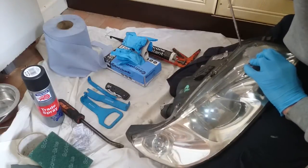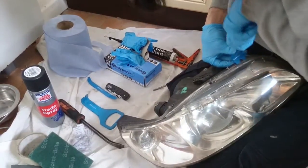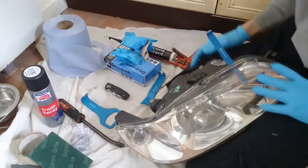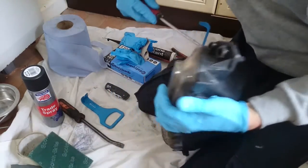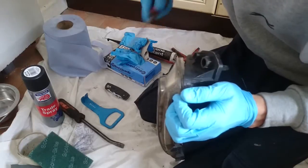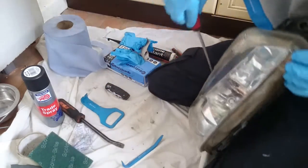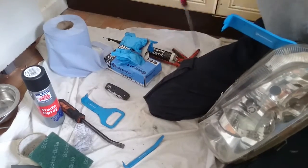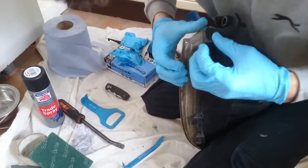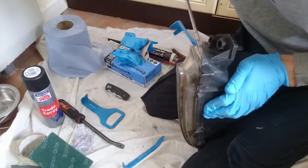I like to use anything from plastic to metal - that's fine. You want to get in there and you can see it starting to open up. I'm using these trim removal tools but anything similar will be fine. You don't want anything too strong that would break the lens or damage the plastic. Work your way around putting in wedges where you can - you don't have to use the wedges, it just holds the headlight open. There are clips underneath - let's see how brittle they are.